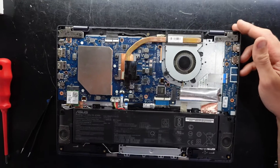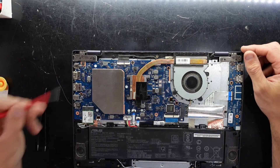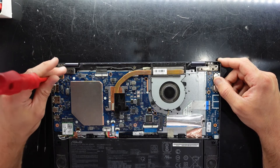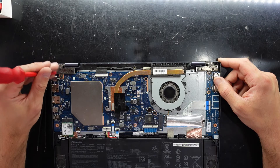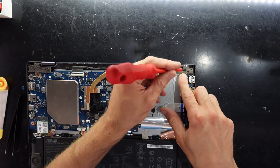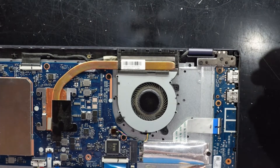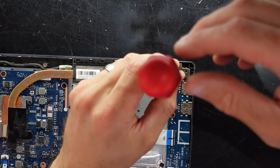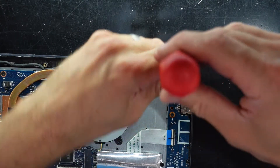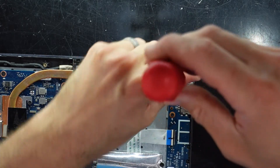While you've got it open, I'd definitely recommend re-torquing the screws on your hinges — especially with these 360-fold laptops. These hinge screws are basically getting a quarter to one-third of a turn. One of them has a fair bit of turnage to it. Loose hinges are definitely going to cause problems, so it's always best to torque them down.